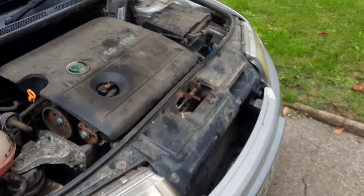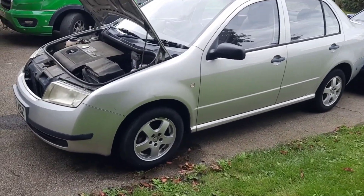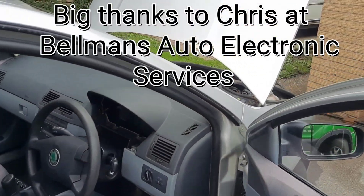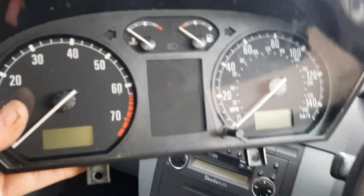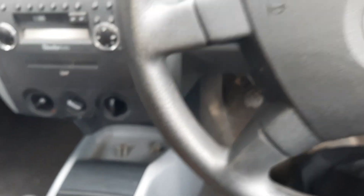I've had the keys coded to the cluster and I've had the wheels fitted as well. I've had the keys coded to the cluster, so now we can refit the original dashboard cluster which houses the immobiliser. This is what was causing the issue before — the flashing light in the middle. That's now coded to the ECU as well for the engine, so I'll put that back in. I've refitted the ignition lock and everything from the other car and put the trim back on just because I had screws and bits everywhere, trying to make it slightly tidier in here.